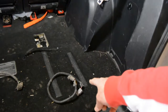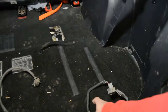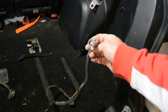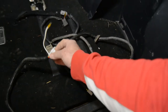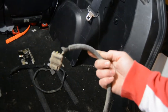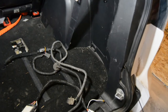If you are going to buy this harness secondhand, you need to be aware of that extra piece there. For this model car, that is an extra part of the harness that goes under the hood. This connects to your battery, and then on the harness in the front, there is a plug that has one lead on it — that is what you need to get the power to the back. The rest of the harness is right here, these two pieces: a ground over here, this is your harness connector, this is the connector to the exterior part of the harness, and then the line to the actual trailer. That's pretty much the harness.